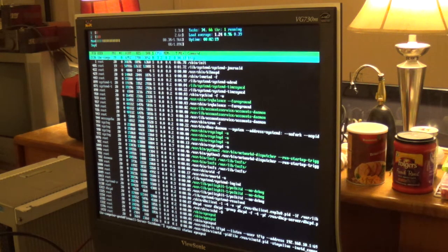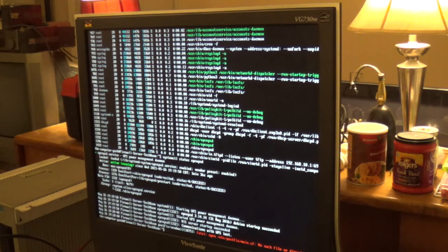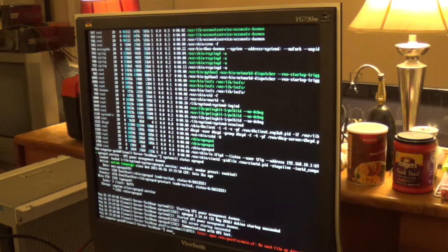systemctl status apcupsd, and of course it's trudging through a ton of binary logs. And yeah, communication with the UPS lost. But this is the first time this system is booted, according to the disk image, since like January 9th. And I really do not have a whole lot of stuff on here in the way of monitoring software. How about we look at the shorewall config? Actually, cd.